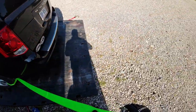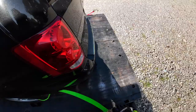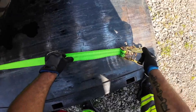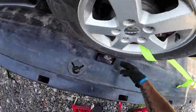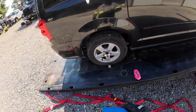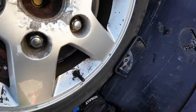When putting straps through a rim, I personally recommend using microfiber towels — that's how I've always done it with lasso straps. If it's a crappy rim you don't need to worry too much, but I don't want to scuff expensive rims on newer vehicles. Also make sure you're not catching the valve from the rim.